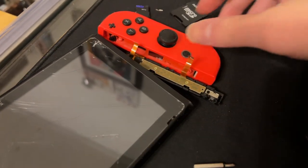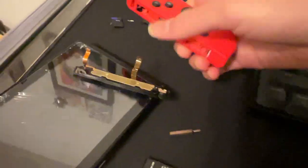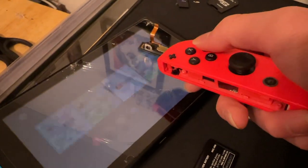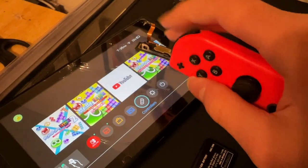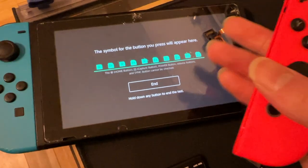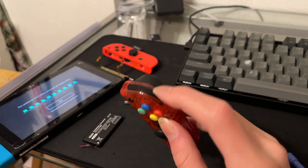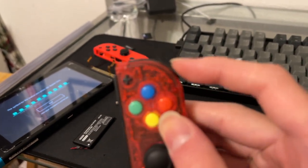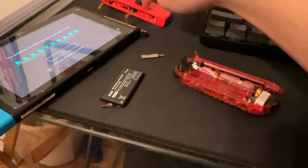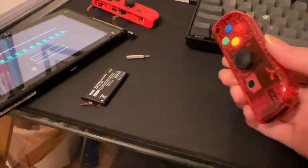Right now I'm in the middle of smashing this Nintendo Switch. This is the red joy-con — the little track came off but the entire joy-con is still somehow working. This is my personal red joy-con; it semi-works, but the R button just doesn't do anything — it's not even a click because the switch inside it is completely broken. I'm going to swap the logic board before I fully smash this Switch, so I'll have a working right red joy-con again.